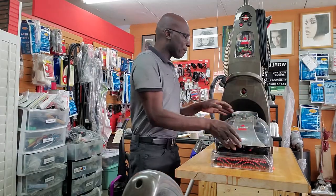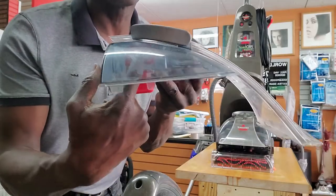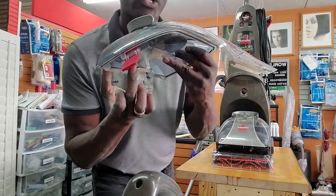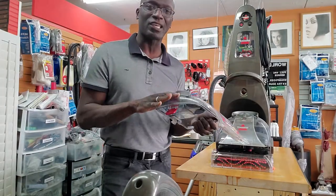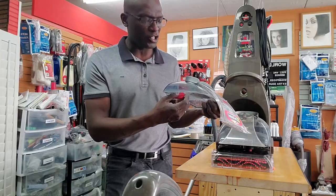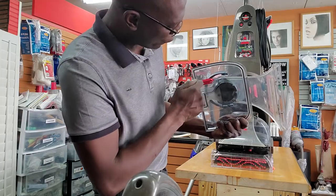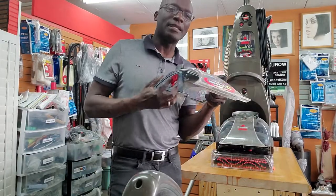So you're checking for cracks, but what I would do even before that is check your filter to see if it has a whole bunch of carpet fibers, because that could be clogging up your suction. Now these things here will just stop your suction right away — if it closes right away and you find it's really having an issue, keep closing for no reason, try just for one shampoo session to take out this cap here. It just pops out — be careful because sometimes the stuff is brittle, so get a flat head screwdriver and just pry it out, and then see if you have that same problem.